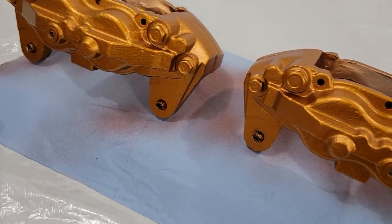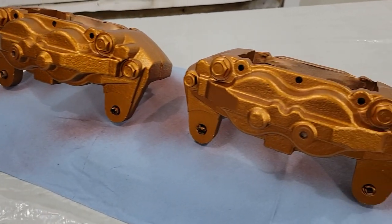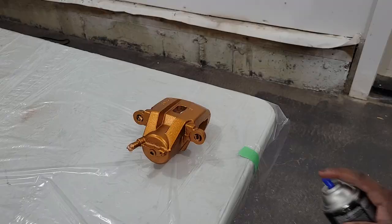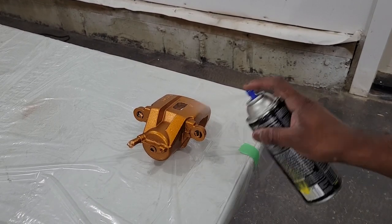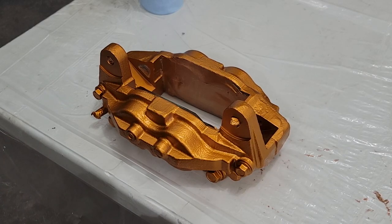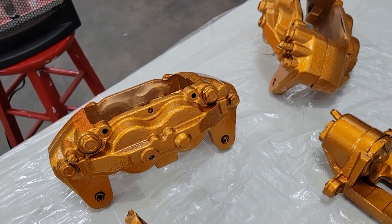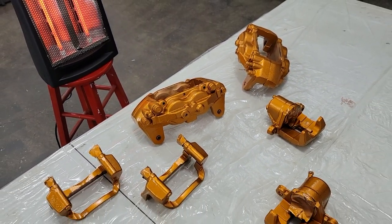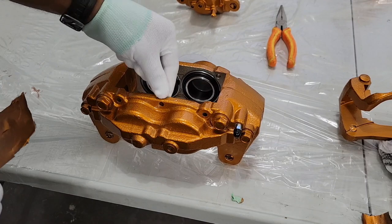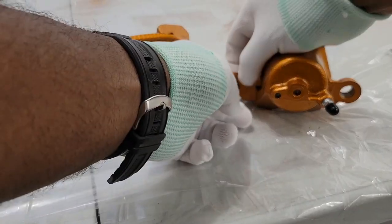You're going to add four coats of base paint instead of just two like with the primer. Each piece ends up with two coats of high temperature primer and four coats of burnt copper base paint — and they're looking pretty damn good. Next, add the high temperature clear coat following essentially the same steps. I used four coats of clear coat to make sure the calipers had enough protection. I left them overnight to fully dry, then the last step is simply removing the tape from each caliper and bracket — oddly satisfying.